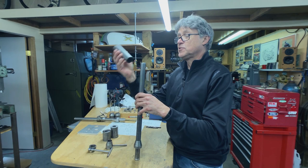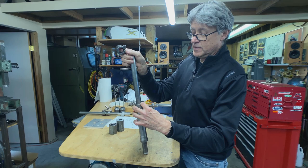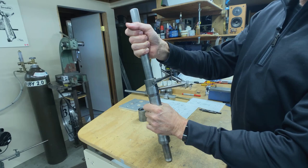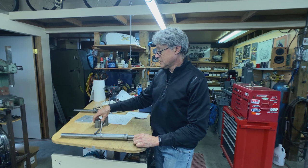Here's a head tube — an inch and eighth head tube. Put that over, a second cone here and then there's a clamp. You notice that on the clamp and the second taper, there's a ramp and each of these ramps matches. So you put this on, lock it, then twist it and that really locks in the head tube. It works on an inch and eighth head tube, but for larger head tubes like a Paragon 44 millimeter, it's too small.